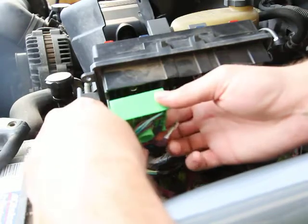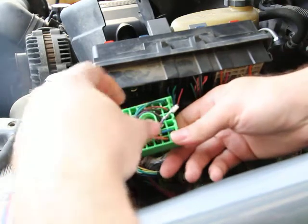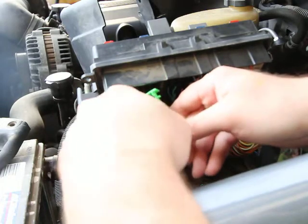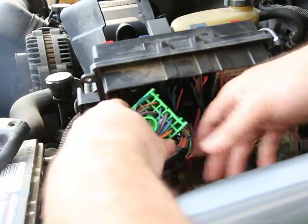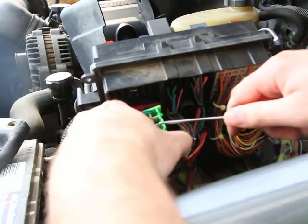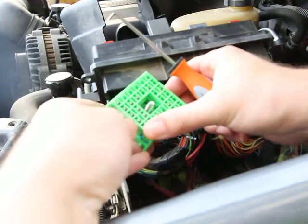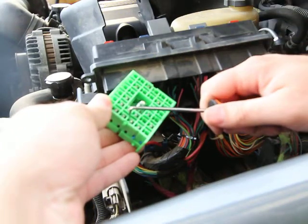We're going to go to the bottom. If it was being pulled out and rotated down, we're going to go to the bottom. So that's A1, 2, 3 — position number 3, A3. We're going to go ahead and put this back in. Alright, hopefully that's fully seated. So it is not fully seated — yours might be a little bit easier because you won't have it bound up in the wiring harness, but I need to get this in just a little bit more to hit the lock. You can try pulling it out. There, that one's fully seated now. So you can come to the front and check — that's going to be A1, 2, and 3.